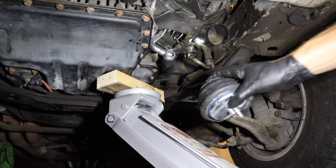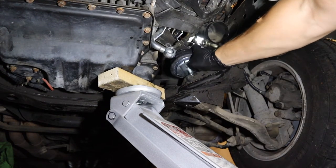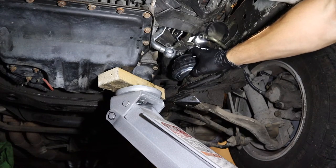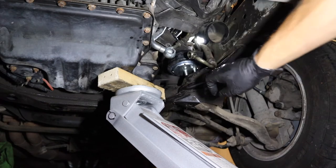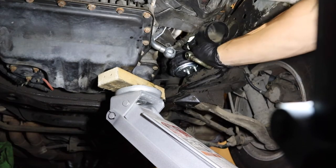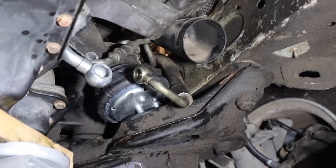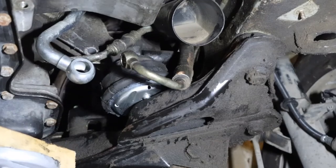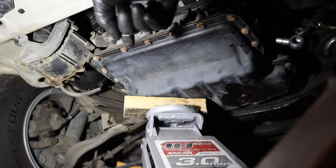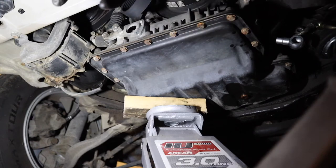Let's head down below. Slip on the new motor mount. First, we've got to raise the motor. Make sure you're putting this in on the right side because they are slightly lopsided. I'm going to see if I can get the top one threaded in a little bit and then drop this down. Let's see if I can start getting this threaded through here. That's threaded in a little bit so that it's hanging. We've tightened up at the top, now it's time to drop this down into the hole.